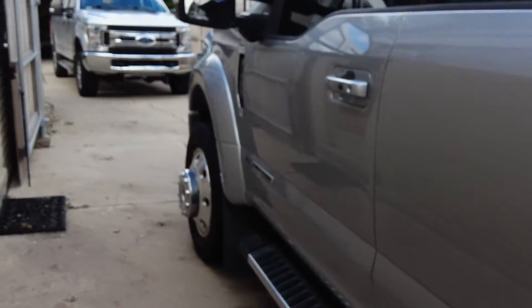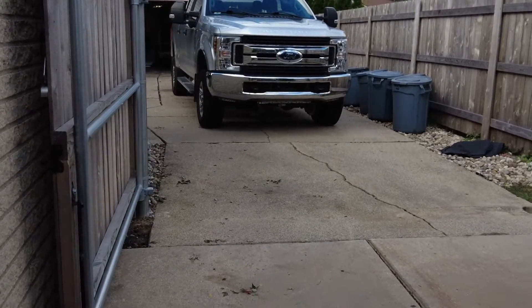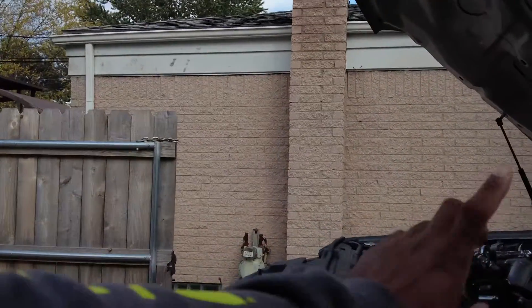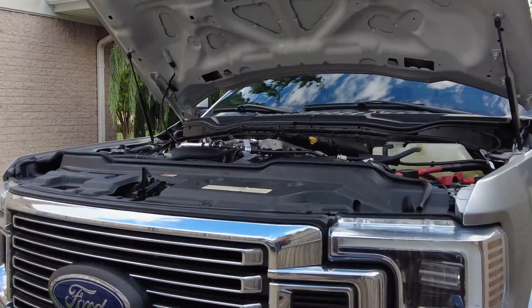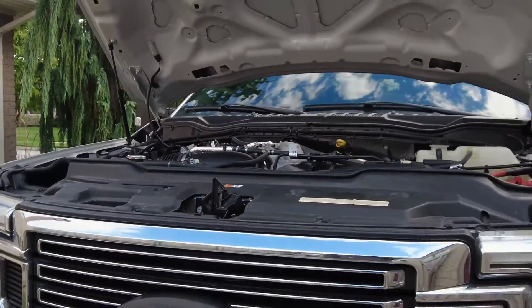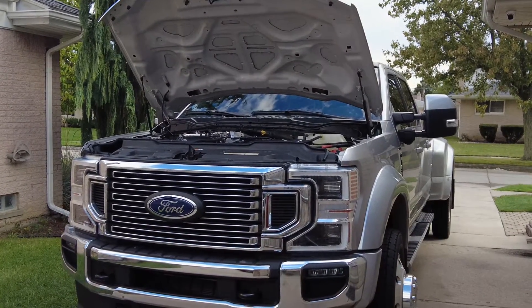You'll have to pay in excess of $10,000 or have your insurance cover it. Ford will not cover DEF contamination on your warranty — if DEF is found in the system, it'll be very obvious that DEF caused the failure and it won't be covered. So you want to get quality diesel fuel and never accidentally put DEF in your fuel tank, even though they're right there next to each other.